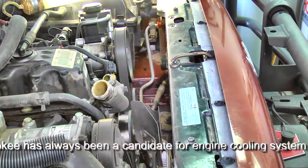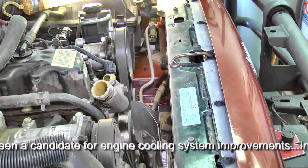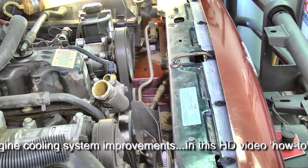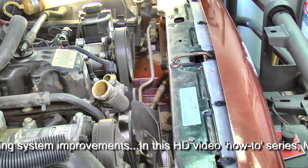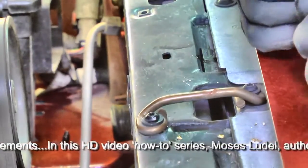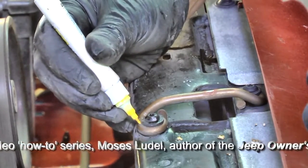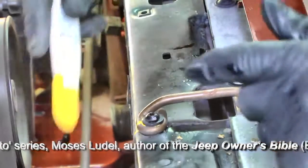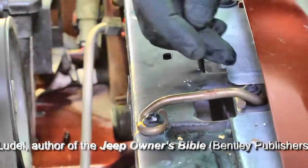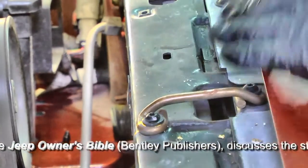We'll go ahead and loosen the strap bolt that supports the upper automatic transmission cooling line at the base of the radiator. We'll mark the striker position so that during reassembly we can make sure to get it in the same position — this metal marker comes in very handy for this. With the striker latch marked, we can remove the hardware from the crossmember.